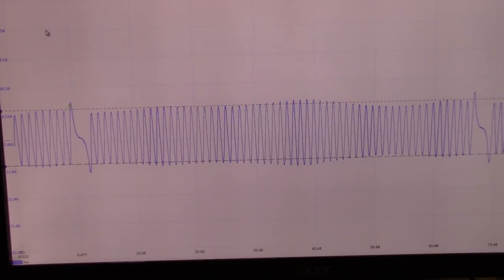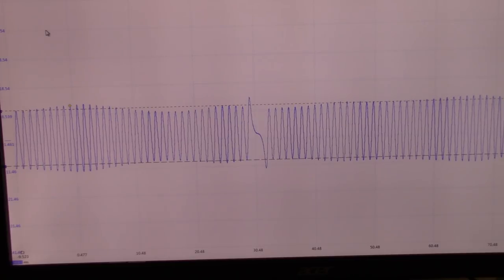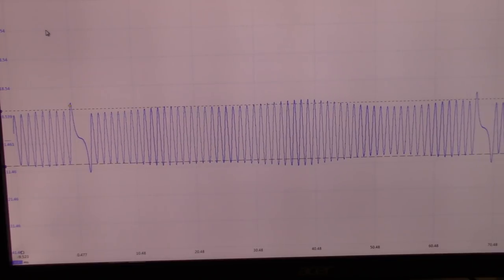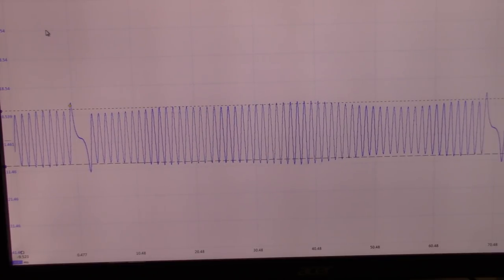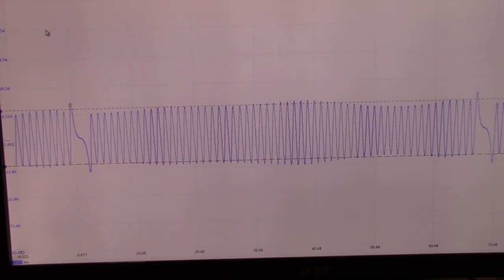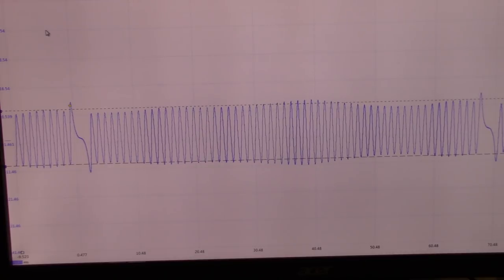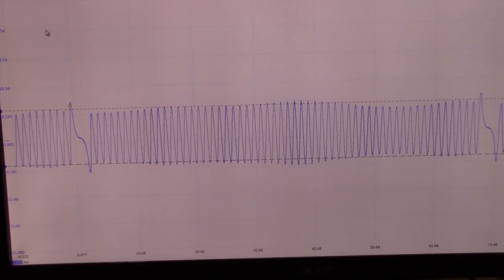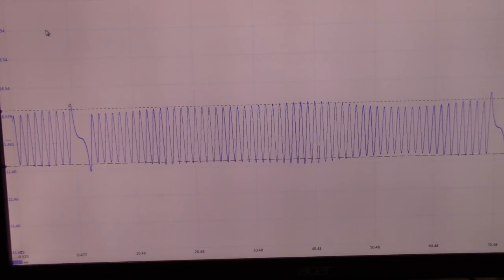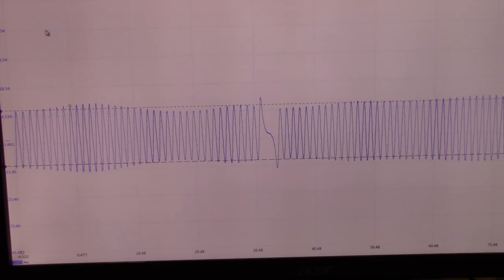So let's keep those cursors in there and see if we find anything different. The misfire counters are very minimal. We have 8, 6, 4, and 1. I'm just going to keep it running for a little bit and see if we can capture any anomaly, something different on the crankshaft waveform to tell us it's dropping, it's missing something. Now cylinder 3 is at 17.